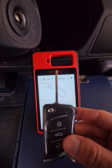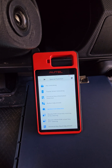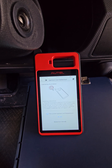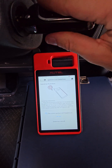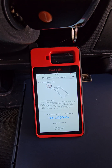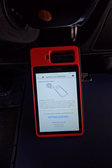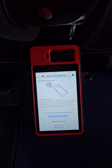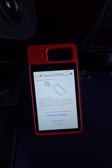We'll go to the unprogrammed key next. I'm going to demonstrate with a fresh menu — back out, select Ignition Coil Detection again, take our unprogrammed key, turn ignition on, and we will see that it detects HITAG2ID46 again. I'll do it one more time. Second reading — now I'm pretty confident that my ignition coil is operating as it should.